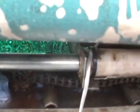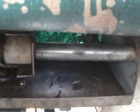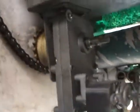The other thing is, in this game, quarters can get in places like you wouldn't believe. I mean, you wouldn't think a quarter could get in there, but believe me, it can. Now, this mechanism here, I'm going to have to turn the light on to show you, is the mechanism that slides the cobras back and forth. Again, that has to be lubricated with a proper lubricant that is not sticky or doesn't gather dust. Again, quarters get down into that trough. Here's the gear motor. Again, these gear motors, after a few years, they go, because they get hot. Here's the bottom tier gear motor. And these are all the cables going up to the various sensors here.